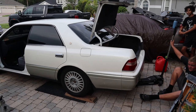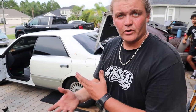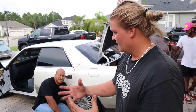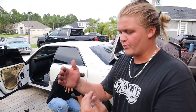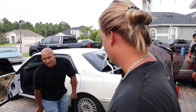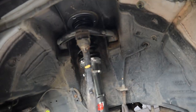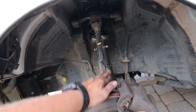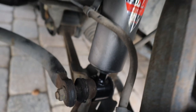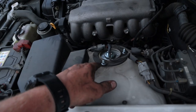That stock setup is max height - but you've got full adjustability. You have a sway bar in the back so it's easier to make sure they hang down and aren't compressed. After we get the front side done we'll be able to lower it all we want. We have probably almost a foot of adjustability so we will definitely be able to dump it. A couple minutes later we've got the front in the air and the new coilover is on. Super easy - it's a true suspension system. Up front you've got a spindle, an upper control arm, and a lower control arm with a mounting bracket. The coilover goes to that bracket with 17s on both ends, and up top I believe these are 12s.